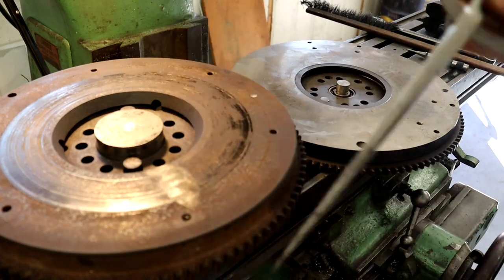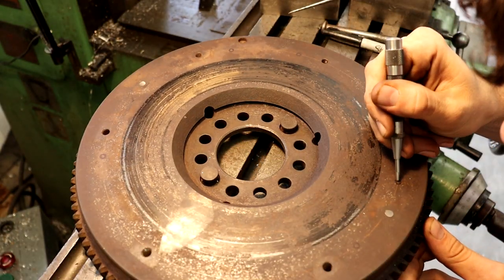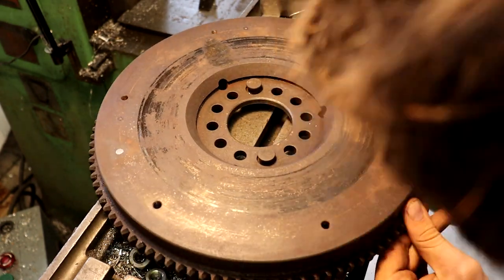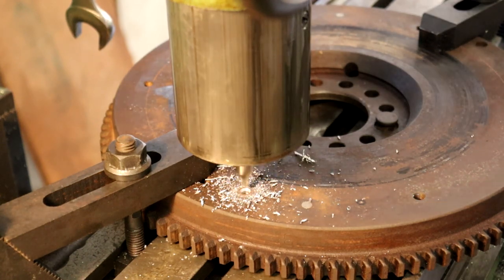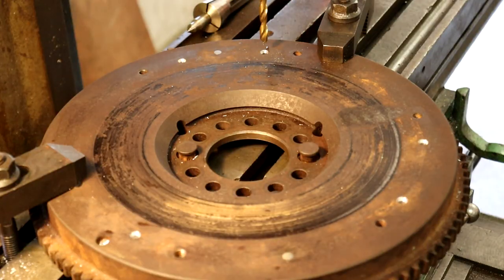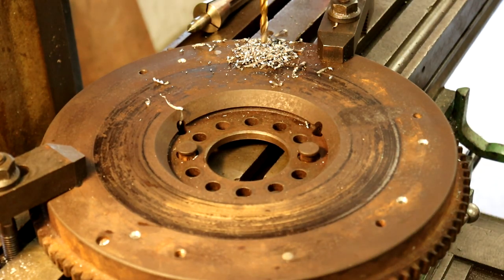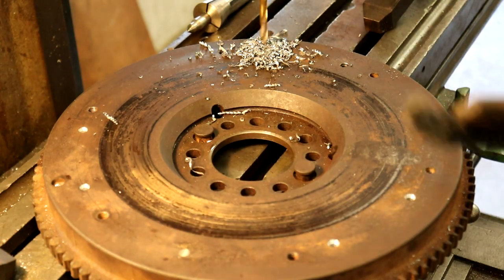You can see I'm just grabbing the circle around the face of it. Then once I did that, I'll take my pressure plate, lay it over top, and mark the positions around that circle where I need to drill my holes. I also measured the distance between the face where the crankshaft mounts to the flywheel and the top face where the clutch plate sits. The Jaguar flywheel turned out to be about 60 thousandths of an inch thicker than the Ford flywheel, but I determined that small amount wasn't significant — the clutch length is adjustable, so any small variation can be taken out in adjustment.